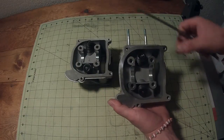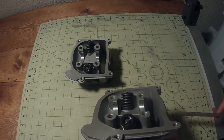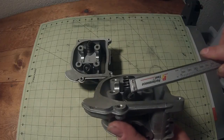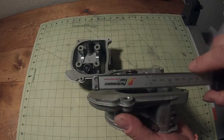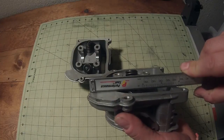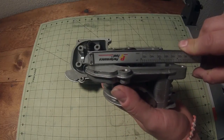So here, I'll get you up close and show you. When we pull in and get a good tight look, you can see the top of that valve spring on the side closest to the wall is lower. So if I take my caliper and slide it down, I can actually pass the lip of that valve spring.